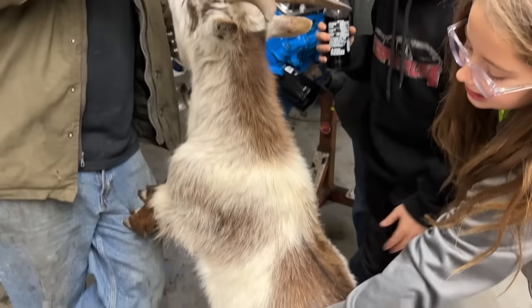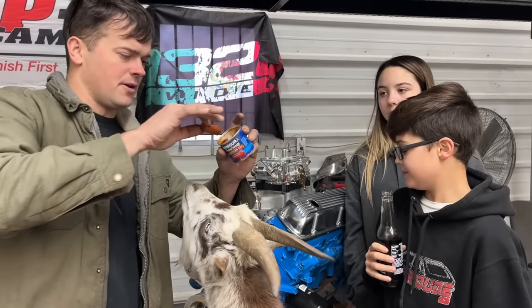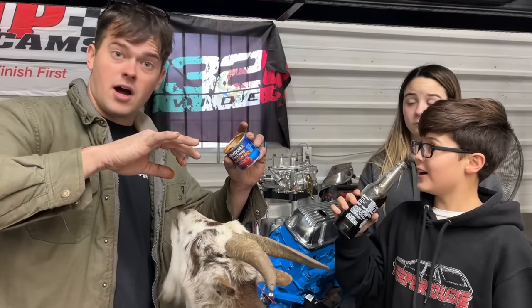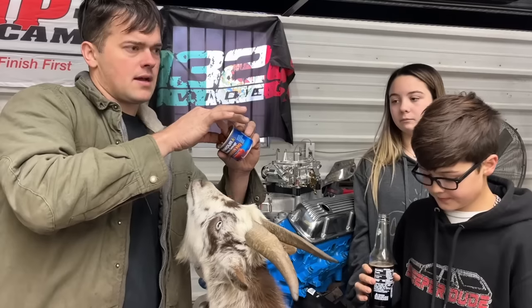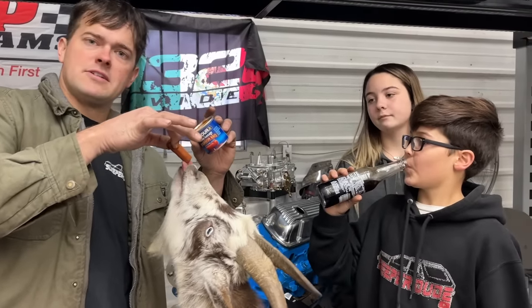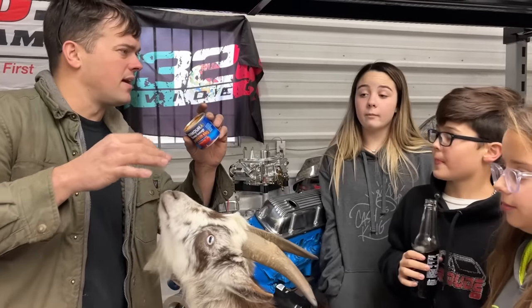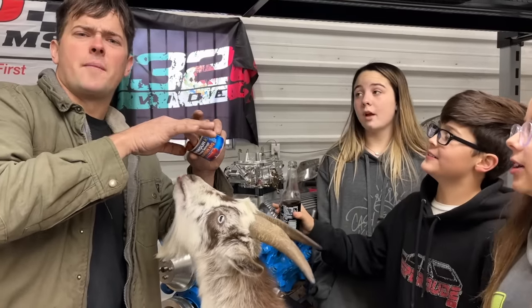Chubs. You know, I guess the 302 was an upgrade though from the 289, so that might help us out a little bit with some torque or maybe some goat stomps. What about that? I know we can't run the old 289 flywheel with this engine because the balance is different. We may just end up doing the T5. I don't know. We'll figure it out. Let us know in the comments what you'd rather see us do.